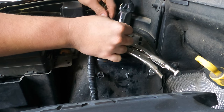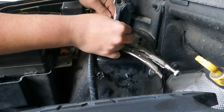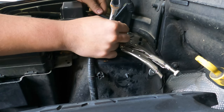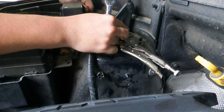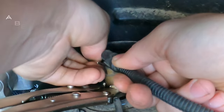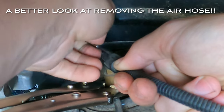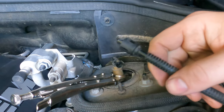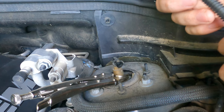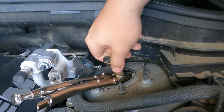I'll go ahead and screw that on, and then you'll just slip this back in. You'll notice it goes in a lot tighter, because the O-ring is actually sealing like it's supposed to now. So that's in there, good to go. And at the same time too, you want to kind of just inspect the lines a little bit, but I don't think mine really have any problems. I didn't hear or see any more leaks other than just this valve right here.